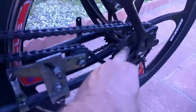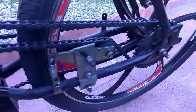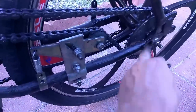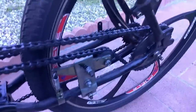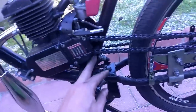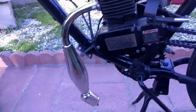The rear sprocket came loose the first time I rode it. After about 25 miles, the Allen head bolts started to come out — one came out so far it hit the frame and bent. I wound up replacing that one and putting lock washers on all of them. I haven't used Loctite on pretty much anything except for the engine side of the studs.